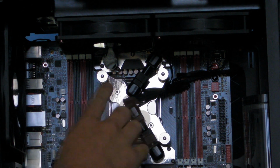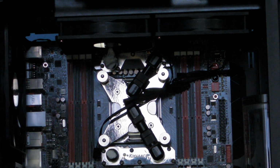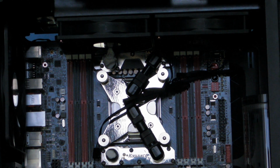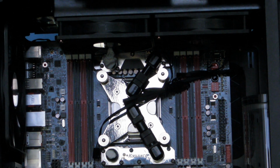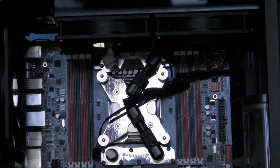It's also going to be, because you can't see at all, the 8-pin power cable. Now that is going to be my biggest, and I do mean my biggest problem, is trying to get that fitted and in. So that is going to be a mission and a half. It's going to be incredibly tight, but I'm hoping that I can get away with it, so I can use the 45 rather than the 30mm thick rad.